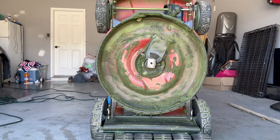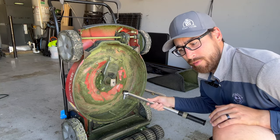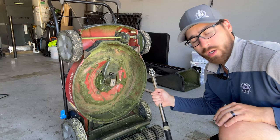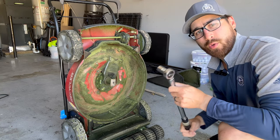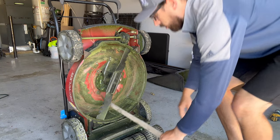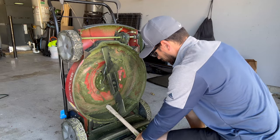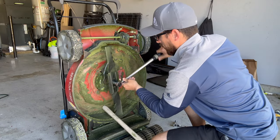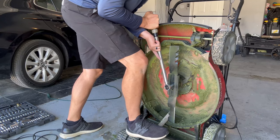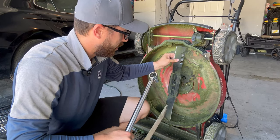Got the goods, let's get back to the house. We're going to clean off the deck first because that looks gross. Just like that — looks pretty good, much better. Now let's get the blade back on the mower. Same concept as how you took it off — put a piece of wood down there, get the blade on, and tighten it up. The Toro needs 60 foot-pounds of force on the torque. We're going to tighten it first with the regular socket, then take our torque wrench. Once you hear that click, you're good to go — it's nice and tight and it's not going anywhere. Make sure you use a torque wrench, otherwise it'll be too loose and you'll have a problem later on.